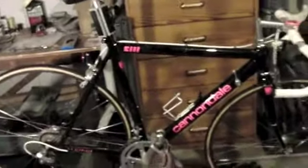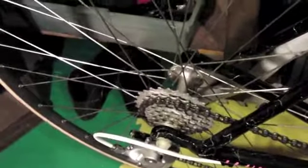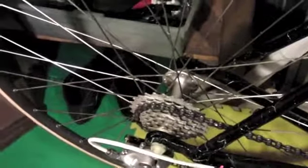Okay YouTube, here we are again — 1991 Cannondale SC 600. In the last video I put on a new cassette, 12 by 28, and in the process of doing that I noticed the hub bearings were a little bit shady. So I went ahead and repacked them. This second video is kind of just the opener — I didn't want to start right in the middle of it. We're gonna look at the wheel and how to re-grease the hub.